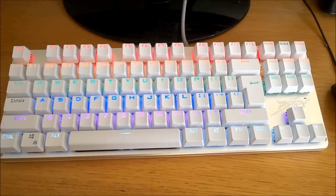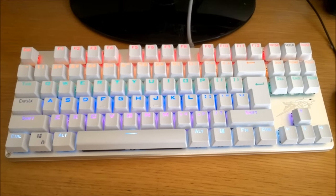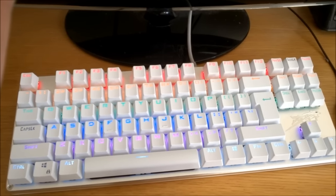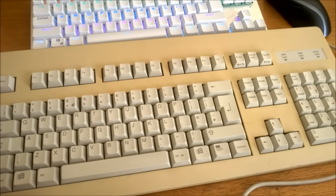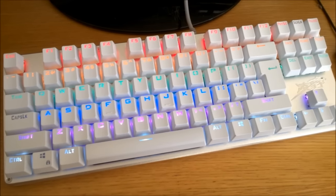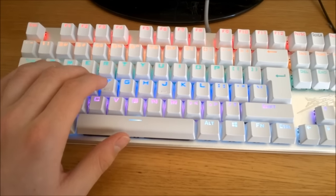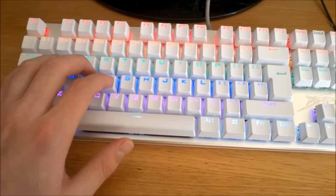So all in all, what do I think of it? I'll be blunt: this is not a very good keyboard. It's rather lackluster and could do with improvements in lots of ways. But that said, it's not fair to expect all that much for just $35 shipped. A run-of-the-mill Cherry G80-3000 starts at around $70 — twice as much — and in all fairness I can't see where the money is going. Despite the cheapness of this keyboard it features backlighting, better build quality, N-key rollover, and double-shot keycaps, none of which the Cherry has. Moreover I prefer the switches.